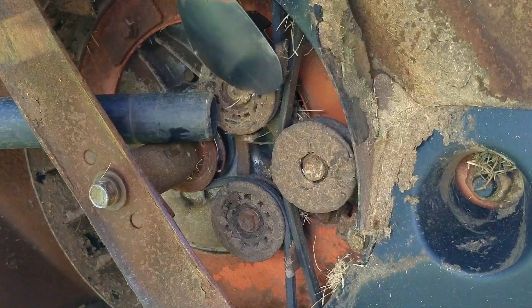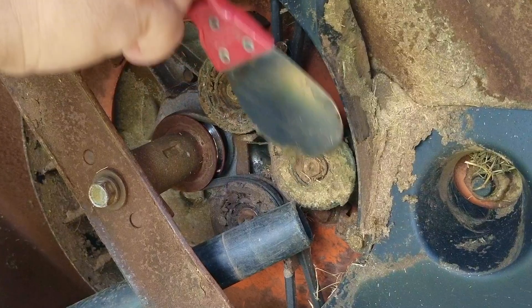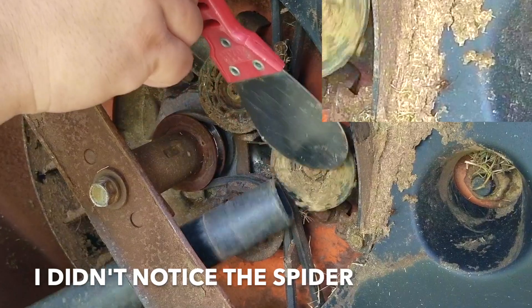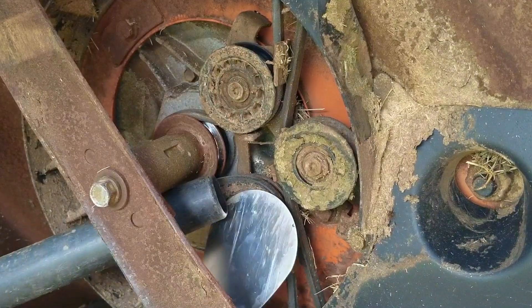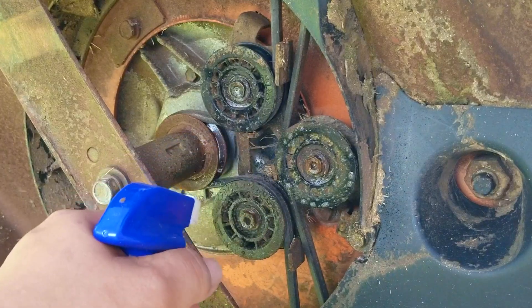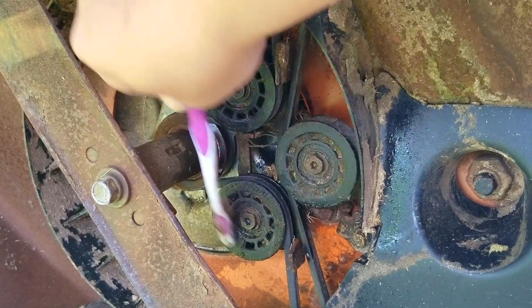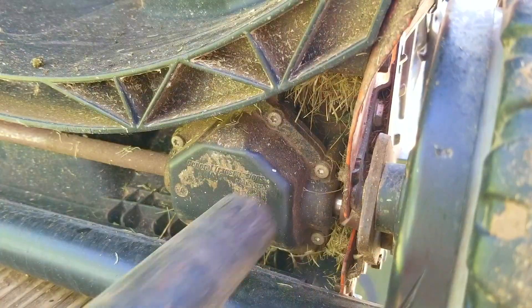While I clean these pulleys, I'm going to explain why I'm bothering to do this. In a past video several years ago, I got to work on my first all-wheel drive Husqvarna, and the problem was that the self-propel did not work. What had happened was that one of the pulleys had come apart, and a second pulley was not spinning like it should, so I had to replace the bad pulley and lubricate the second one. These pulleys simply do not last under the mowing deck and will eventually need to be replaced, but to keep them working, you can either lubricate them or, better yet, repack them with bearing grease. I don't have any bearing grease on hand, so I intend on cleaning the pulleys and the bearing seals so I can spray some lube on them. The seals prevent dirt from getting to the grease, but I don't find them to be waterproof, so all I do is spray the lube on the seals and it should get inside.